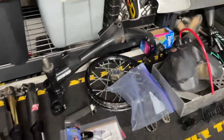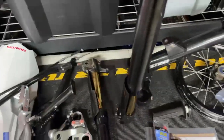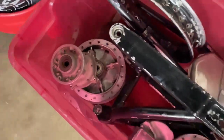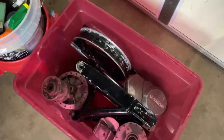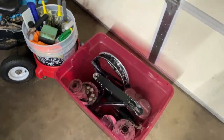Got the full mod 50 all tore down, got the motor over there. I ordered fork seals for the forks and I'm going to put new oil on them — they've been leaking oil, they're real springy. I have a swing arm, K-Lex hubs, a 65 front hub for this pit bike — I'm going to get those Cerakoted bronze. Swing arm, the subframe, the Honda side cover, some other little hubs and a rim — I'm going to get all that powder coated and Cerakoted.